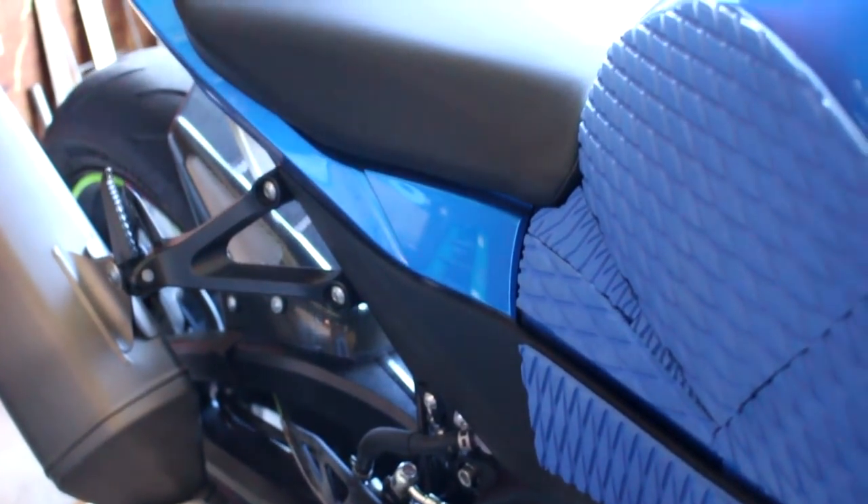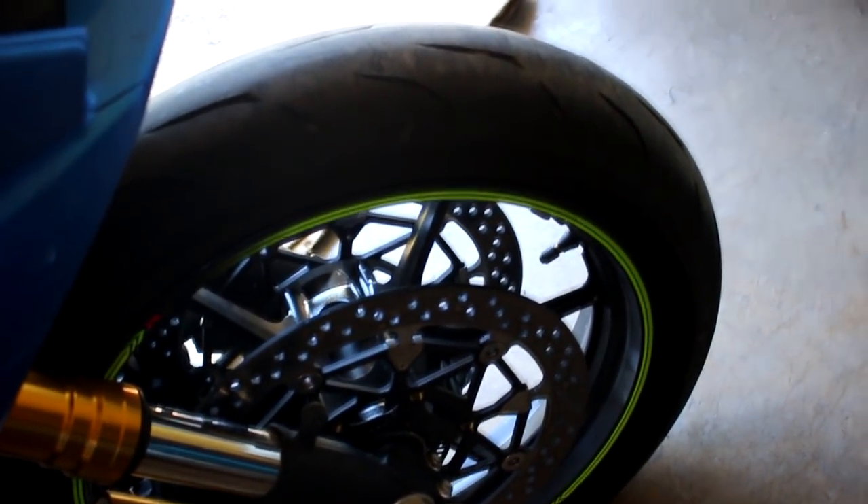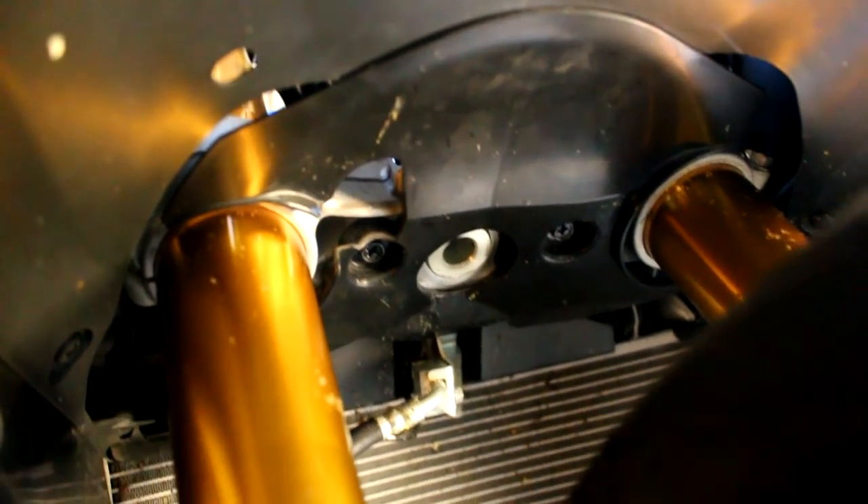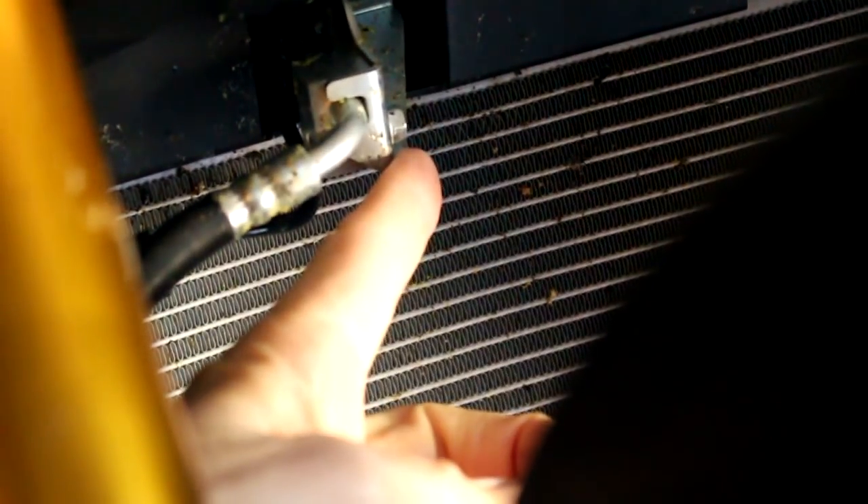Next, we're going to take the seat off and the side panels. The brake lines work their way back right up underneath the gas tank area — there's a little bolt on the right-hand side. Before we start unbolting everything, I just want to observe how all the brake lines route to the pump first. A little observation before we start wrenching away.